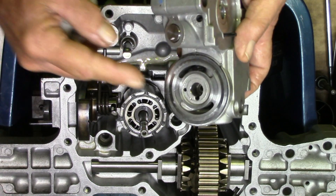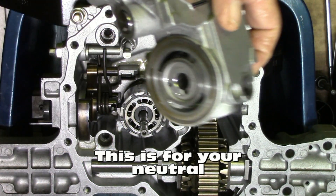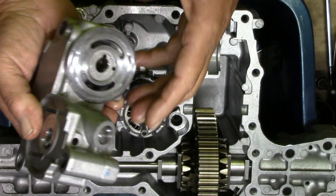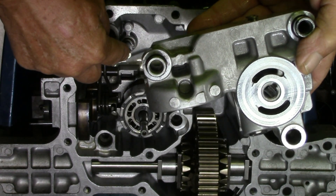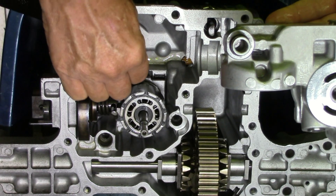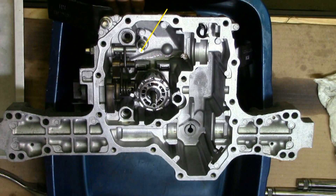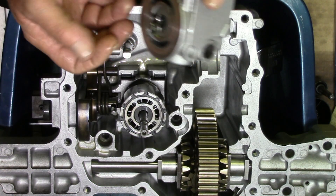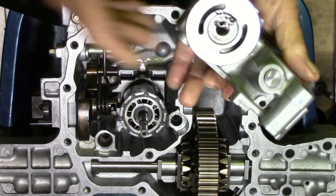You've got the pin that goes in the pump, and then you've got another pin that's going to go into the drive piston that sets out on the transmission — it pokes out down in the bottom and moves in and out by your neutral. The best way to position this would be to have that facing the front side of the case. I want to take some assembly lube and fill that hole up — I don't want that thing to fall out. A little bit more on the back side, so I know it's not going to fall out when I put this thing down in there.